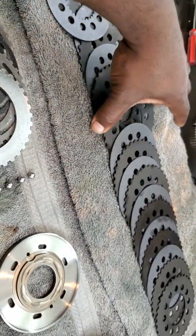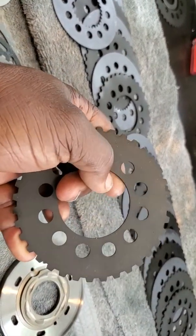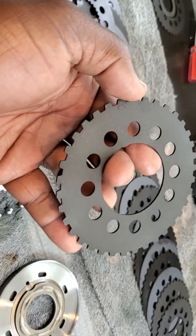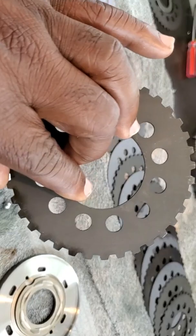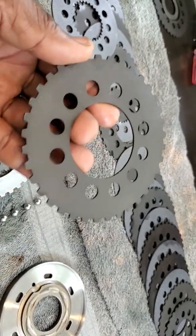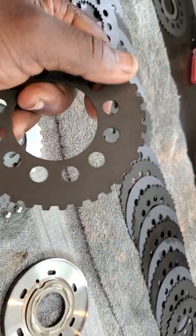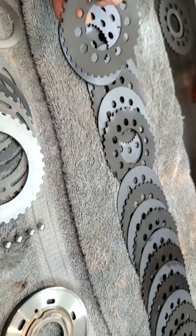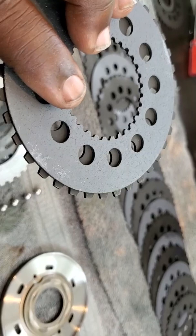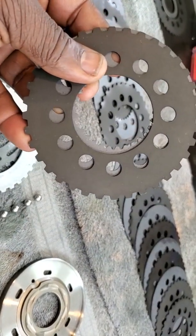These are steel friction plates covered with a moly-dm ceramic compound, so it is rough to the touch — kind of feels like a transmission clutch. However, the friction discs themselves are smooth. This compound on the outside is literally just a compound designed to help keep it from corroding. You should expect that if you ever tear your coupler down after use, you will see that this is a shiny disc and the black coating will essentially come off as the friction surface allows it to spin against the plate. So don't be worried — everything's good.